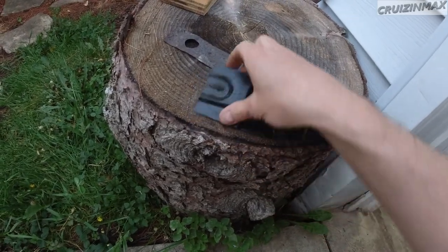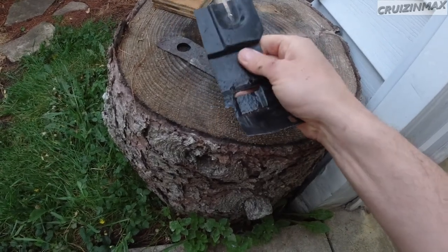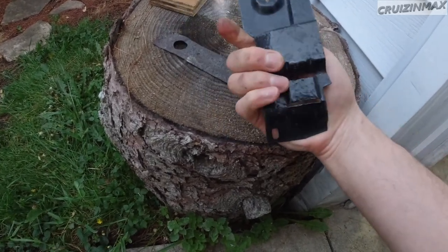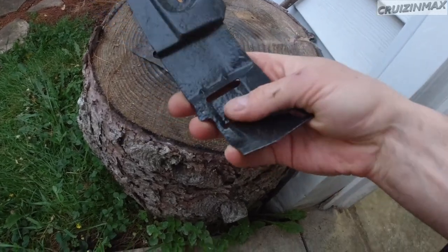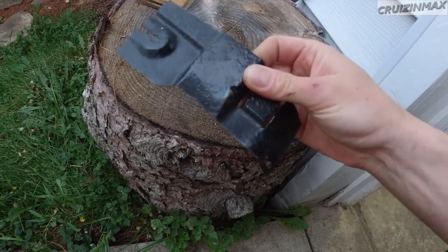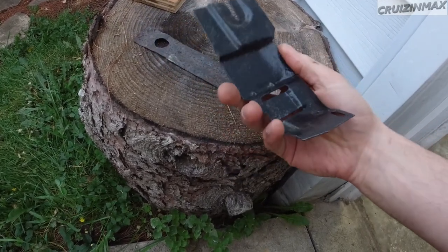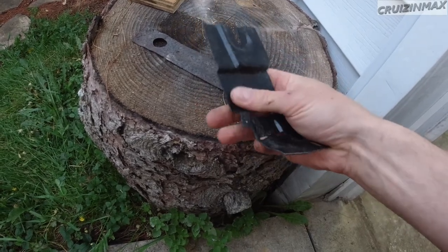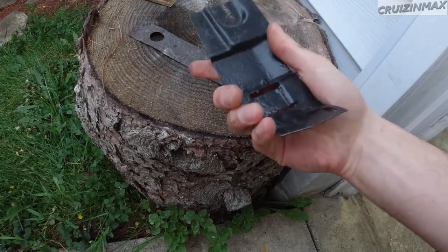Look, this is in perfect condition sitting outside. And at first it was rusty, all of it. You can see it's pitted from the rust. So Corroseal, I'm sure it was at least 2, 3, 4 coats, maybe even more, until it gets black, and then that oil-based Rust-Oleum black paint. Good stuff. So that's what I'm gonna do now.